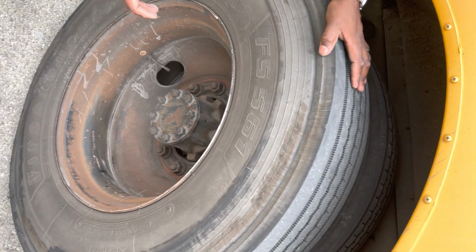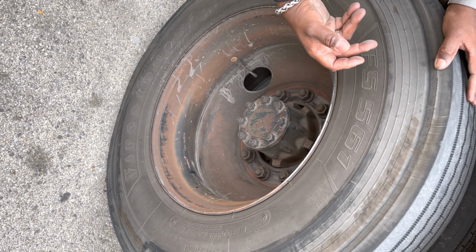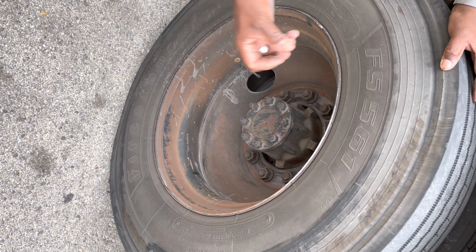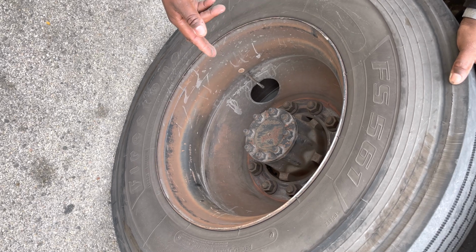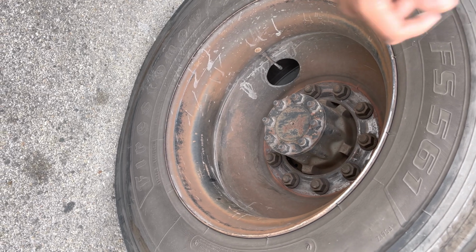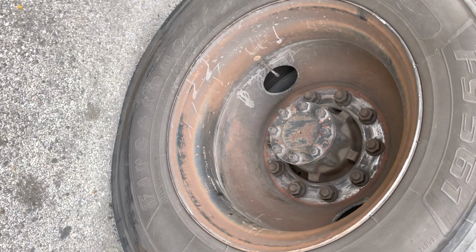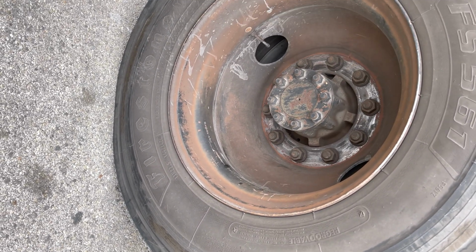Then we're gonna go down to our rim. We have 2 rims because we have 2 tires. They're gonna be securely mounted. We're gonna make sure that they're not cracked, not damaged, that there's no illegal welds. We're gonna then go to our lug nuts, making sure our lug nuts are securely mounted, that they're not distorted, that there's no shiny threads, there's no rust trails indicating looseness, and that all lug nuts are present.